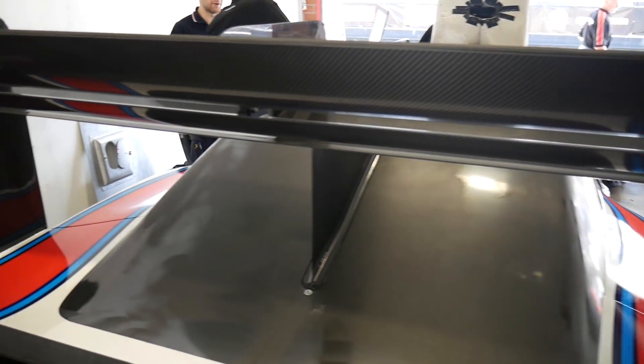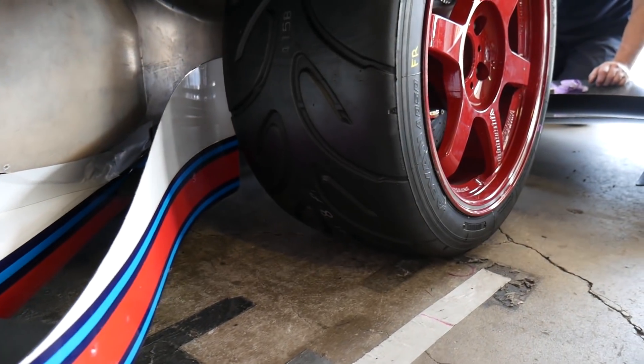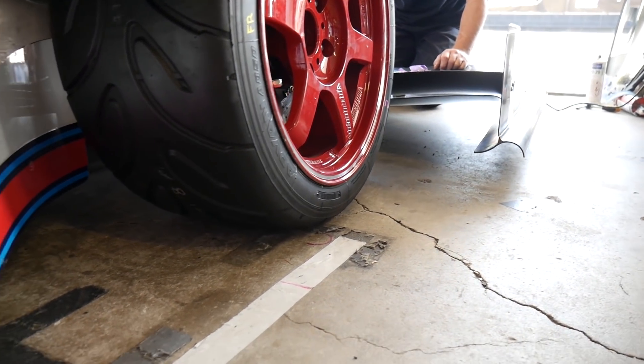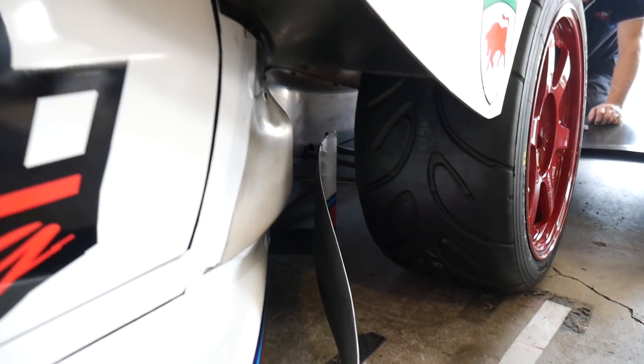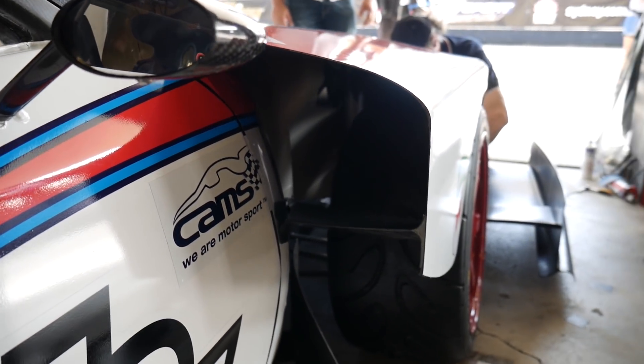Is there any reason you chose that strategy instead of just tuning purely through the rear wing? The rear wing is an alternative, but it has a big impact on total vehicle drag and therefore top speed. Ideally we'd like to decouple the two. Through CFD we can easily adjust total downforce and maintain balance by adjusting both canards and rear wing together, or adjust balance alone by only adjusting the front canards.